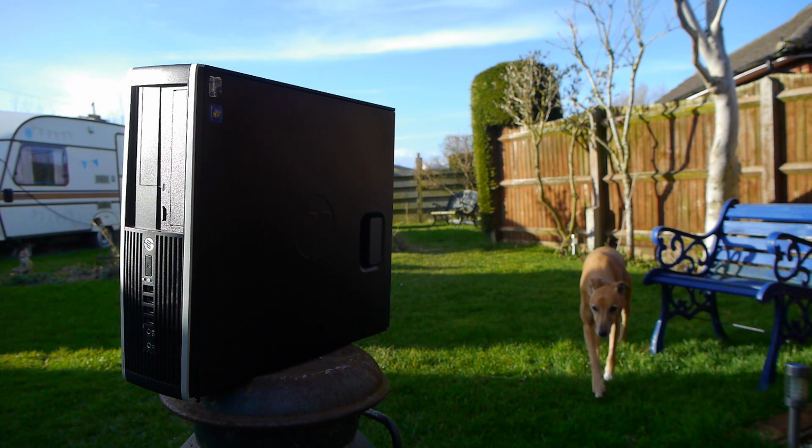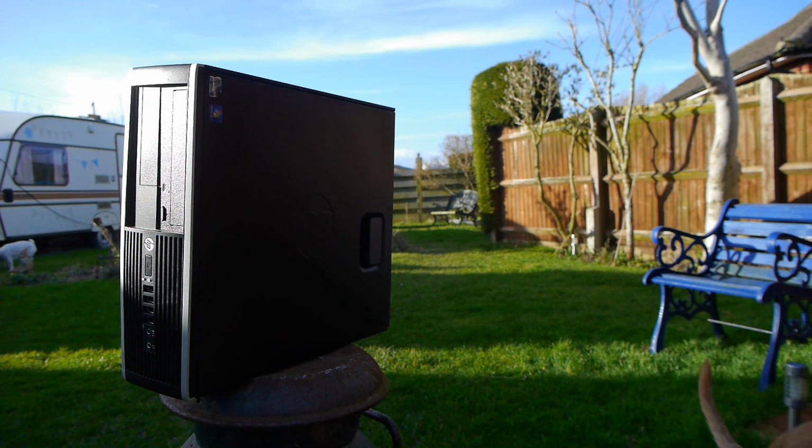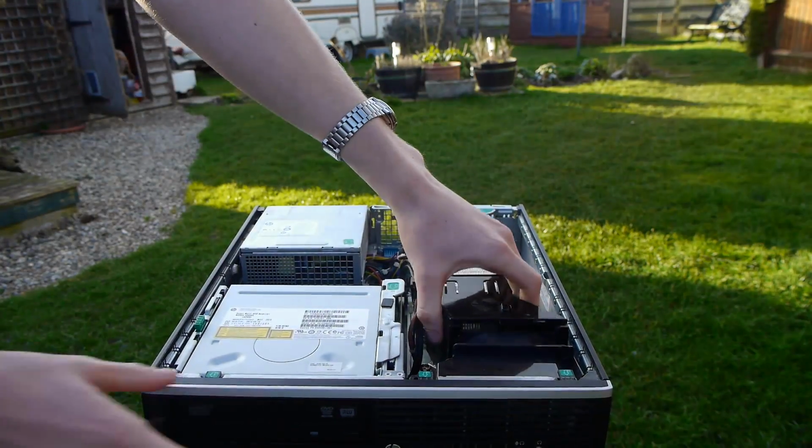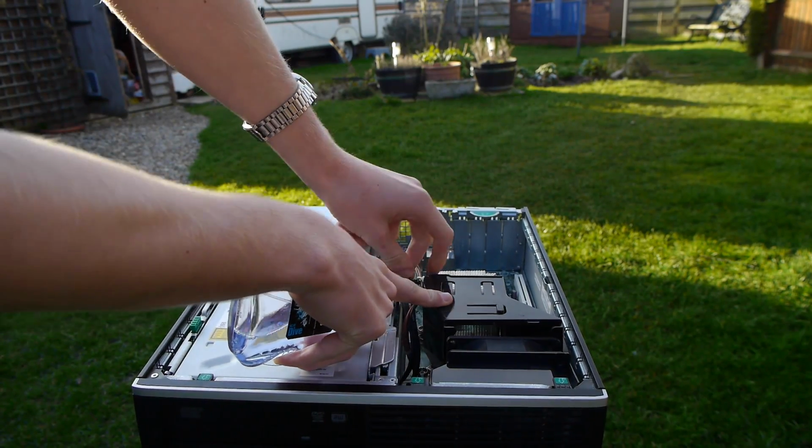Alternatively, a GT 740 would also be about the same power-wise, so generally these things are quite low-powered and very much common in most markets actually. It has 2GB of DDR3 VRAM, which is the main issue with the card. However, as you can see, it's an ideal pairing given its cheap price in 2018, and realistically the fact that you don't really want to spend much more than £50 if you're buying a budget PC like this. And the performance with the Core i3 is quite matching given the price of the cards we're looking at. But generally, no matter which one of these cards you go for, you'll see pretty much the same performance.